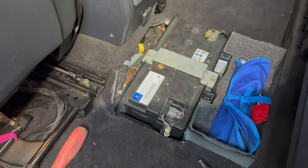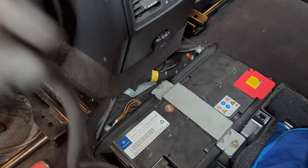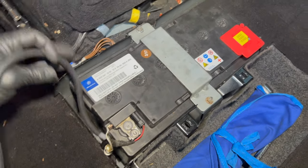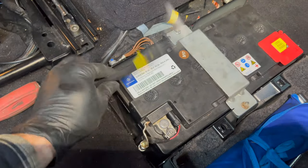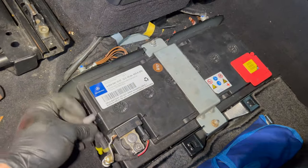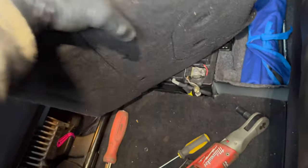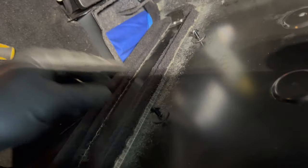We've got the main battery back in and reconnected. Put the little cover back on and reconnect the vent line. The new battery doesn't have a hole for a vent on the side of it, so I'm just going to put the vent line onto the main battery — that'll be good enough. It's not really venting anywhere anyway since that vent doesn't go outside. Now we've got the battery in; I can put our cover back on, just making sure the bolts are lined up on the bottom side so they go into those two plastic notched holes.